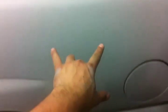So the holes were all throughout here down the middle, and it was a lot of work to get them tapped. After I sanded, I'd keep hitting them. They were still high. Then I finally just had to sit there and tap all the high spots down and keep tapping them down, and every time I tapped them down, the stuff busted out of the holes, and I had to reapply fiber strand. I definitely wanted those holes filled with fiber strand, or some kind of a waterproof sealant, or a waterproof fiberglass filler.